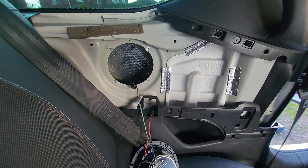Actually, I may have made a mistake - you don't have to drill out those rivets for the speaker. What you can actually do is go behind the polystyrene cover on the side of the wall. If you unclip the wire from behind, you can just reach your hand in, unclip the wire, and bring the wire more towards the polystyrene hole - just pull that down and bring the wire out that way. Then you can do all the splicing that's about to come next without drilling anything. If you're replacing the rear speakers and fitting the subwoofer at the same time, do them both together.